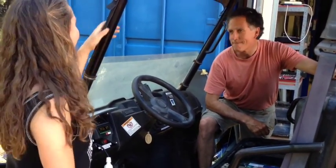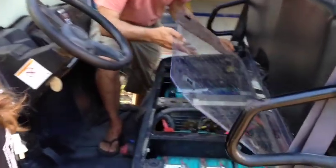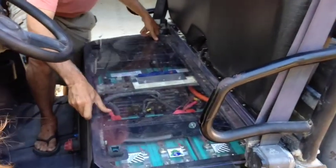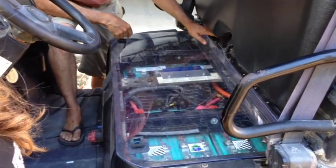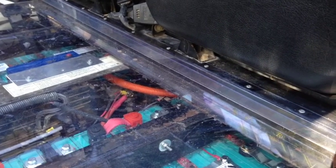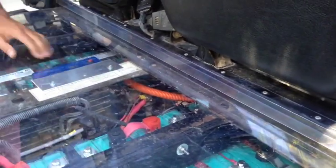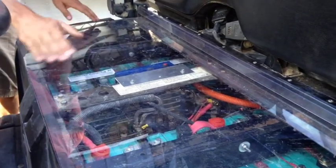Okay, looks like lots of fun. Yeah — master fabricator Jamie made this cover that fits on top of the battery pack. Another one of the issues we've found is if this area gets wet, all the water runs off and down into the batteries. I mean, that's nuts — of course it's going to get wet the first time you drive it in the rain; that tray is going to fill with water and flood down into the batteries. So Jamie made this cover that slots up underneath so the water runs off, and we've got rubber seals around it so the water's not going to run all over the batteries.